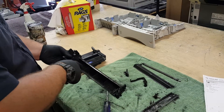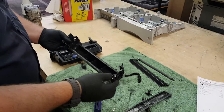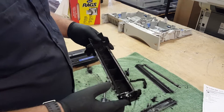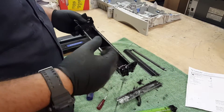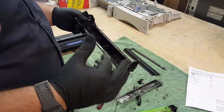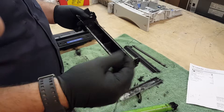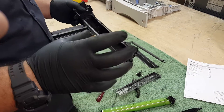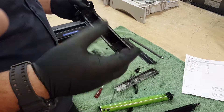It can fill up on either side — it's supposed to spill into the other side, but you rarely see that. This is going to happen on any cartridge. It can happen on a lot of cartridges depending on how efficiently the cartridge printed. But you see it especially on the 12ARs, the Q2612s, and a lot of the smaller unit cartridges like the 85A.